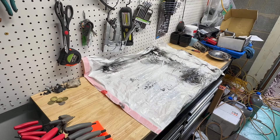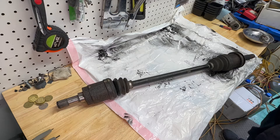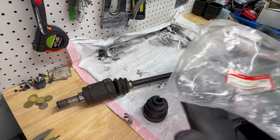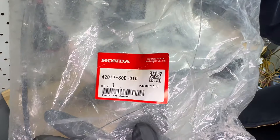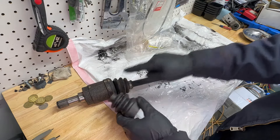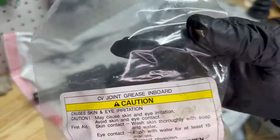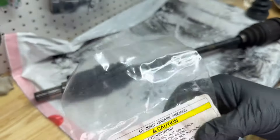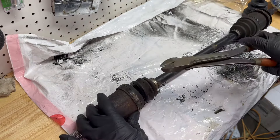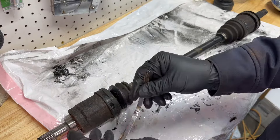Prepare for a big mess. Here we have the new boot from this kit — part number right there. This part number is the same for all four boots, inner and outer, on left and right side of CRVs. It came with CV joint grease labeled inboard, and based on my research, the part that goes into the rear diff is the inboard. Start by cutting these bands off — once the band is off you can trash it.